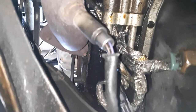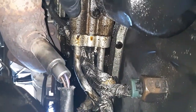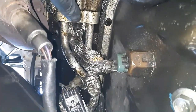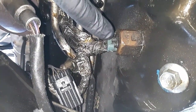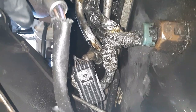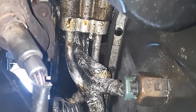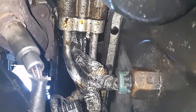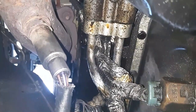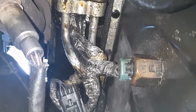Here's somewhat of a better view. There is what we're changing — that's the oil filter, the oil filter adapter, and the cooler line. But we've got to take some things loose first. We've got the oil level sensor in the oil pan, the wire for the O2 sensors, and hiding back there — right there is a NOx sensor. They're all run right in between there. Not the worst place in the world to route wire, but not the best. It keeps it off the exhaust, so I'll probably put it back the way it is.